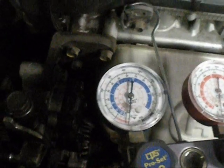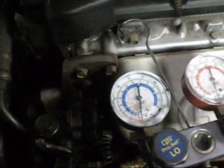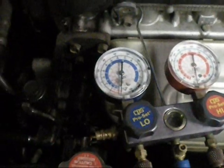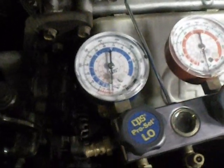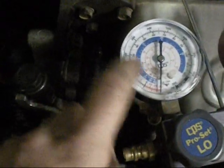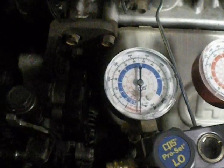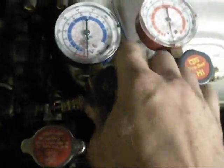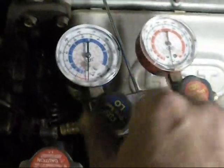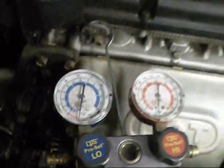So, that is good. I always recommend to do this on a warm engine so all the pipe work is warm and all the moisture can evaporate even easier at low pressures. It's not the hottest today. Yeah, no, it's good because that's with tap off. Tap off. Perfect. Not moving an iota. I'll let it sit like that for about 20 minutes, make sure. Then I'll reopen them, just pull out any extra moisture. And then throw some gas in.